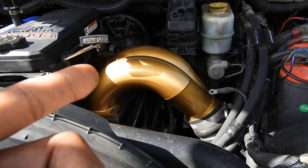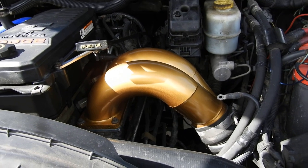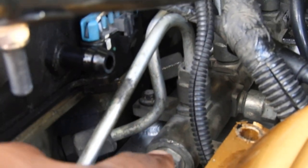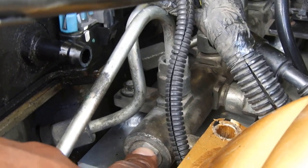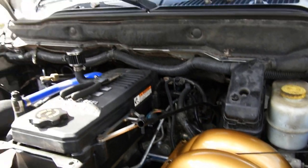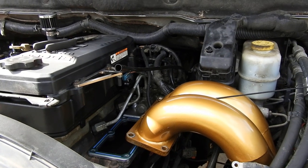So we're gonna use that. I'm going to go ahead and get the manifold removed — you guys have already seen me remove this before for the EGR delete mod. I went ahead and got the intake manifold out just enough. There is where your fuel rail plug is going to be. It's probably gonna be tight, so be ready to break it loose. There's gonna be a crush washer in there — make sure you take the washer and put it on your new one, unless it's completely shot.